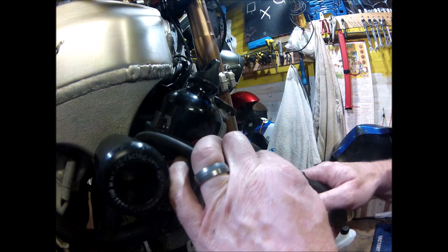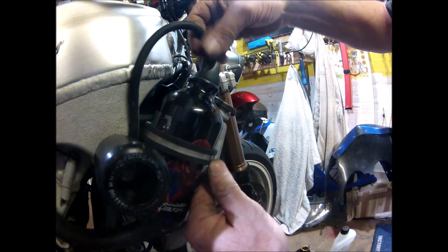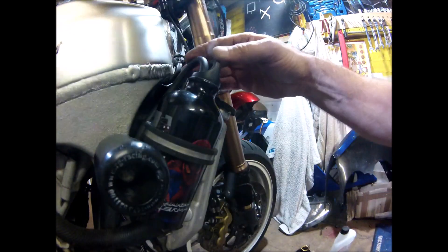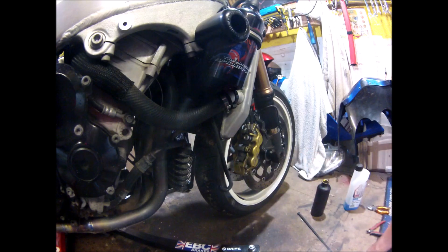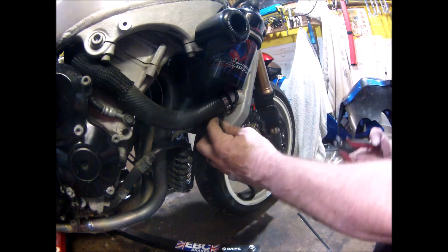If you're going to buy one of those eBay tanks, personally I'd say you've got to cut a hole in it to allow for the expansion. Then all this wants to do is just tuck in there a bit — it's just to let the air out. I'll drip it off the bottom of the radiator. I'll probably cut the hook out of it so it doesn't catch on kerb stones while driving down the road.